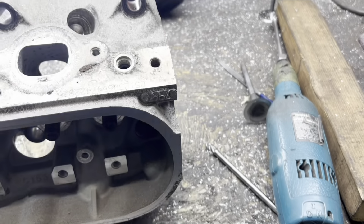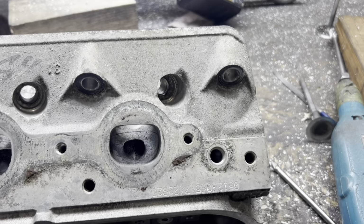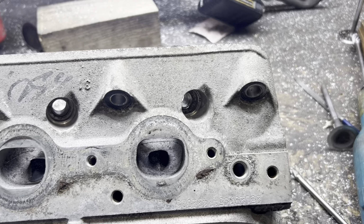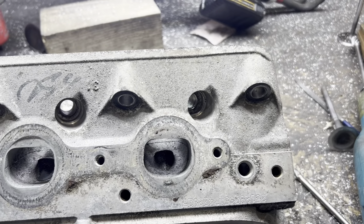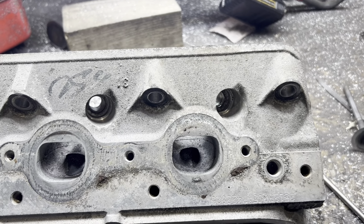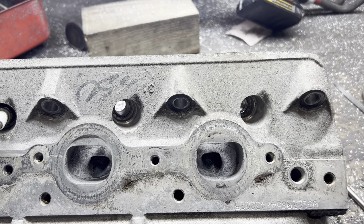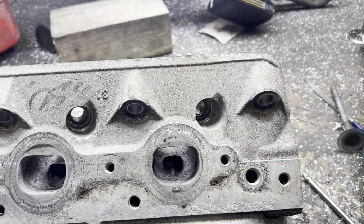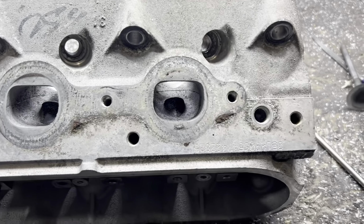We're continuing on the 799 cylinder head. Watch the other videos on how to improve yourself with some basic stuff, where he gained about 30 CFM. Then I showed in the last video my regular porting. It went from 247 to 311, so 54 CFM. Some places gain 15, some places gain 30, some places gain 52, 51. Watch the video to see.